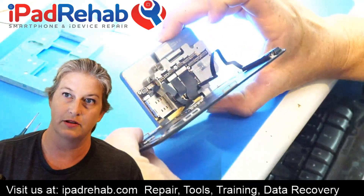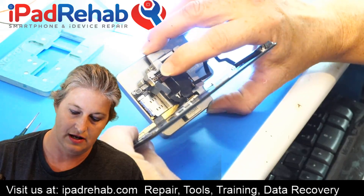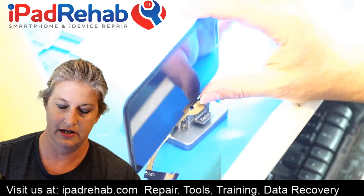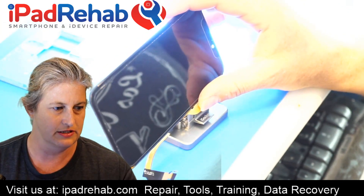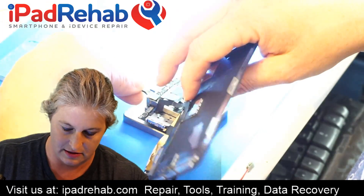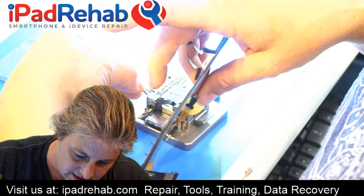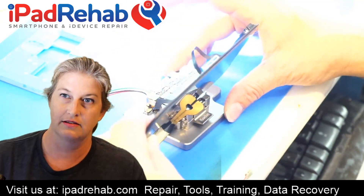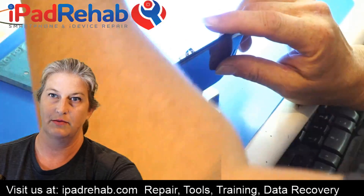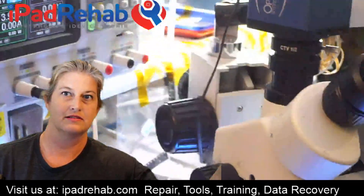So what I've done now is I've plugged in: this is your charge port, this is your display, this is your digitizer connector, and then we have our battery connector. For battery I'm going to use the iPad Rehab supply favorite — the squid. Everybody likes different squids for different reasons, and this one has an iPhone X connector. Not all of the iPad Rehab squids have iPhone X. The digitizer connector already popped off again — let me plug that in. I have this connected to my DC power supply and I'm going to plug it in.